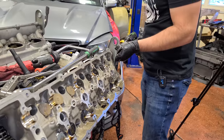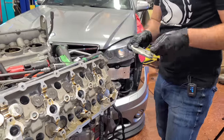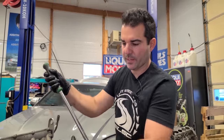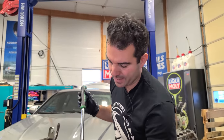Taking this bracket off helps. Look, even this bracket says AMG. So you can do the head bolt job with the engine in the car, of course. You're working on pretty much everything from the top. You don't even have to get to the main timing cover. So it's not that bad of a job, really.